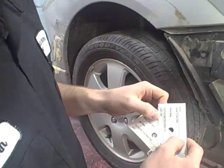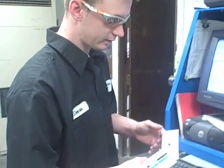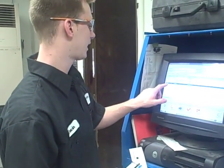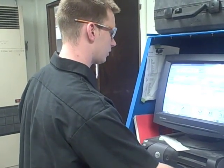It's 4987 and it's got a red tint to it, so we'll have to go back to the computer and find which paint code has the red tint — that will be the one that we mix up. Since we determined that the one we need has a reddish tint, we come back and find 4987 with the R code, which right here says 'redder.' That's the one we need, so we'll double click on it.